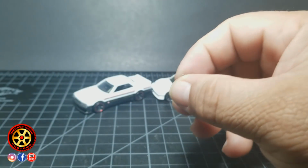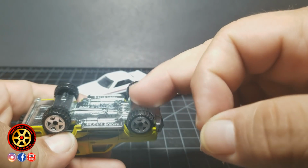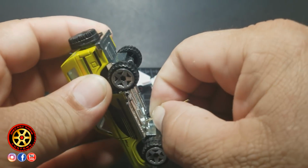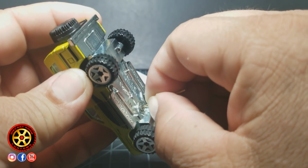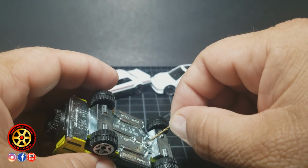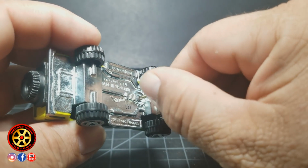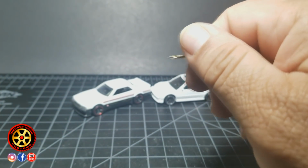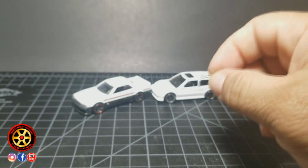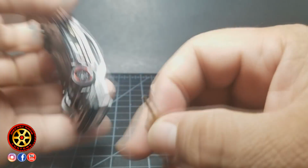This size even works for usually big vehicles like this 4x4. They have a big lump usually, so if you have it sticking out a little bit, it's gonna be impossible for the drill bit to get into the rivet. So with this size, you could move it out a little bit more. That way the drill bit can do its work still inside the drill, and it's still not that long. For 4x4, if you want to use the original size, sure, but again, you are running the risk of breaking the drill bit, and we want to save money here.